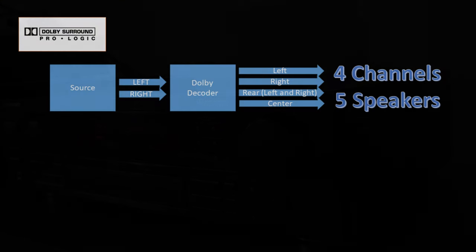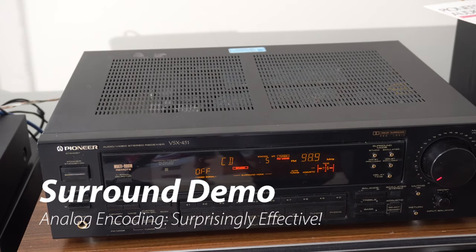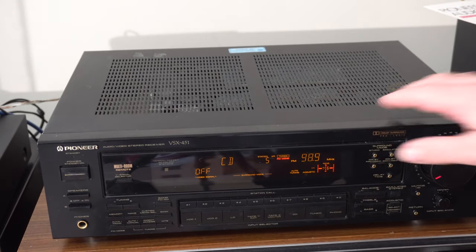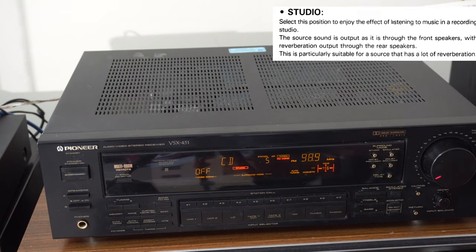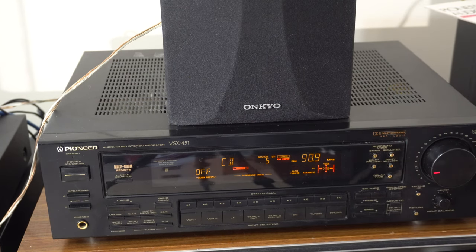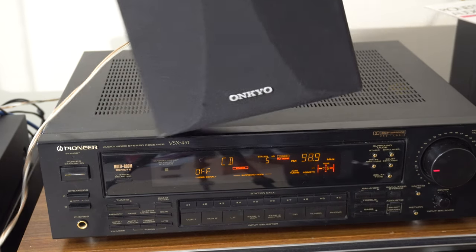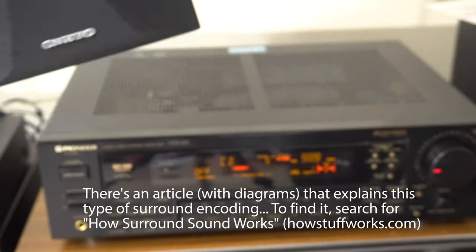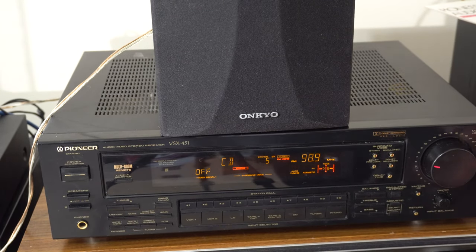I can't really demonstrate a rear surround signal over YouTube. However, to give you an idea of how effective this type of analog encoding could be, I'm going to try a little trick — play a bit of the 1978 song 'If I Can't Have You' and then disable the main speakers to show you how the surround processing on this VSX-451 can almost completely isolate the piano to the rear speakers. Here's the surround speaker. Now we're going to drop out the main speakers. So simply by manipulating the original stereo track with left and right channels, we can get this. Obviously that's a very contrived, coincidental example, but you can see how effective these encoding systems could be if you did everything to spec.